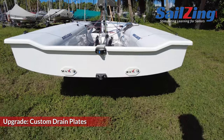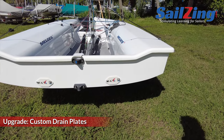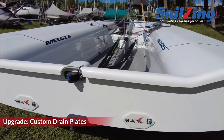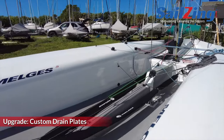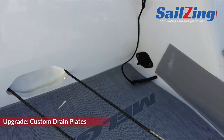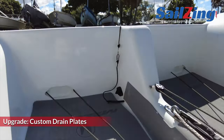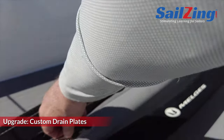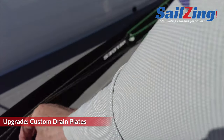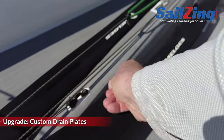The rear drains are these two plates. In my case, I've done a custom set out of Delrin, which is an engineered plastic, and laser engraved our team logo onto those. And the way they work is they're basically bungeed in, and so if you get a lot of water pressure, they're able to give and let water out. And you can change the pressure by undoing this hook and releasing some of the pressure so that they can be more sloppy if you've got a lot of water that you want to get out. Otherwise, you can just leave this attached up here.